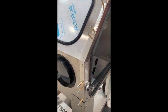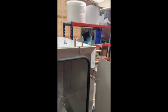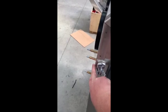First stage of assembly: take the right hand panel and fit it up to the main body. We're using temporary rivets known as clecos — the gold things you can see standing up. You've got one flange, two flange, three flanges to connect.